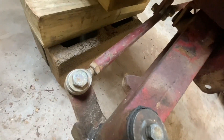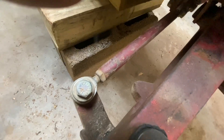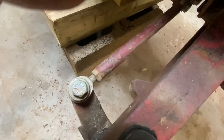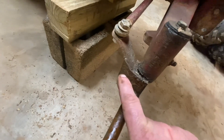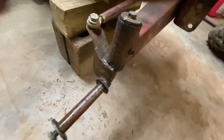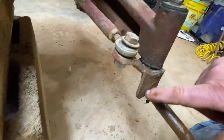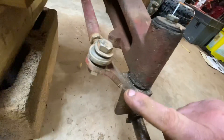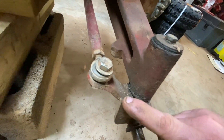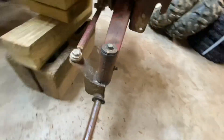These are actually the factory tie rods that I cut the ends off of and drilled and tapped and just put some economy three-eighths economy rod ends on there. That's it. Spindles - Wheelhorse spindle, you got to brace them. If you're going to start popping wheelies and bashing into things like a caveman, you will bust the spindles off of a Wheelhorse. This kind of conquered two things - it helps brace this part of the spindle on that bend and also helps brace the steering arm itself. I've seen these steering arms bust loose from the spindle. That's no good either.